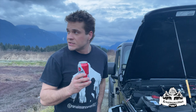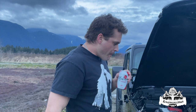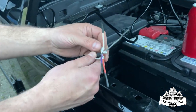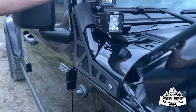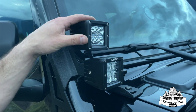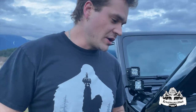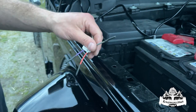It's getting dark here, it's about time to get these lights set up. Okay, we're at our auxiliary switches — we got one, two, three, and four. Three and four are 15 amps. I worked it out: each one of these pod lights runs 40 watts, so that's a total of 160 watts, which equals under 15 amps. So we're going to hook all four of these up to our number four auxiliary switch.